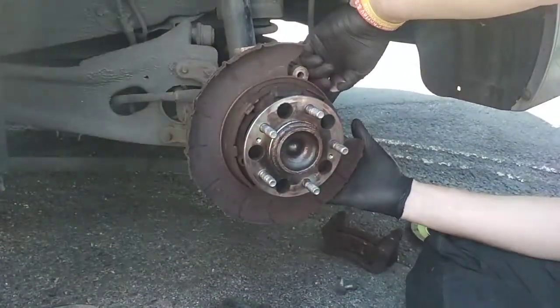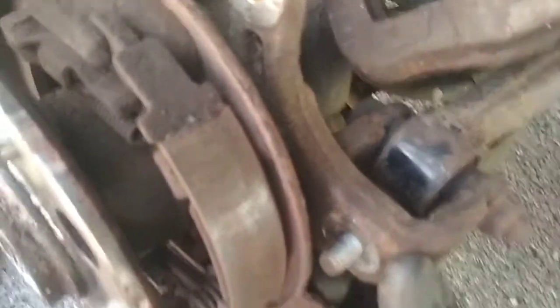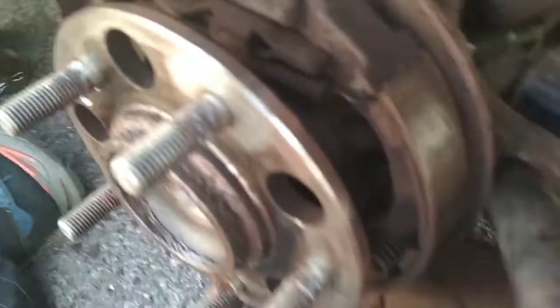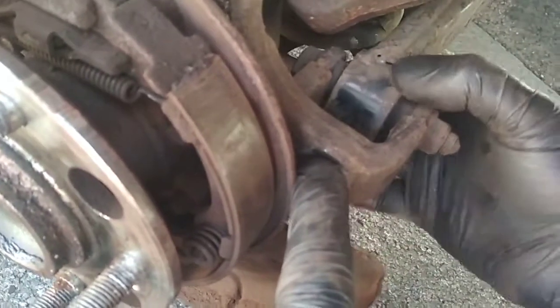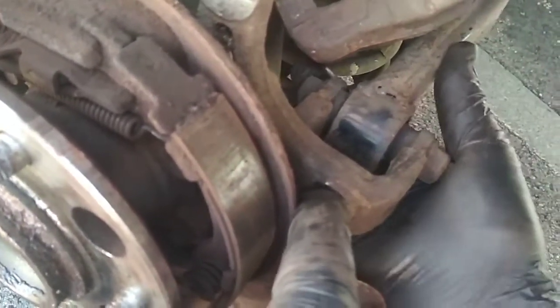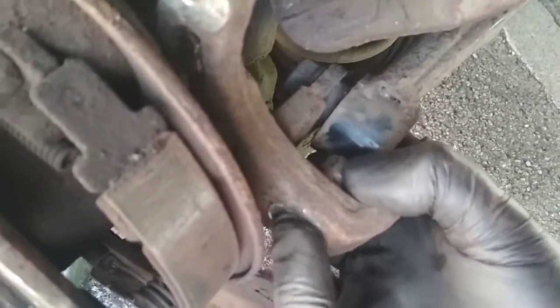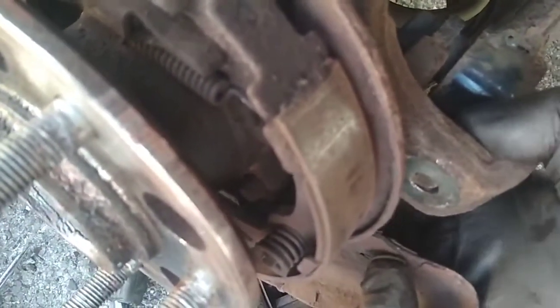If you're looking here — this is the lower bolt for the caliper holder. The official line is to break this joint and take the suspension arm out, which is a complete waste of time. You can see the top of the bolt, just undo it, and if you pull it out to its full extent it actually enables you to get the caliper holder out of the way. Job saved.